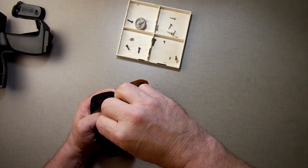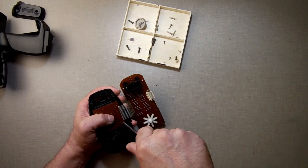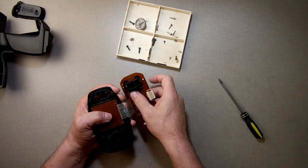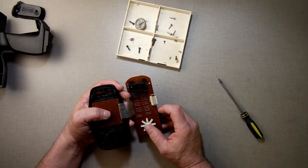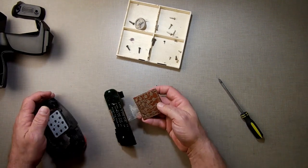Now there is always the possibility that a diode is bad, but odds are no, because there's too many of them that are having issues for it to be one of these diodes. Because what these diodes do is let multiple controls go on fewer lines, and they don't cross over and short out or cause you to think that you're pushing one when you're not.